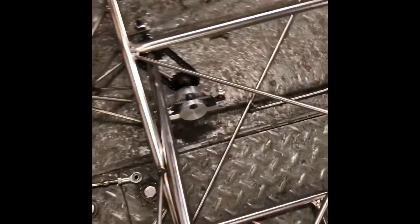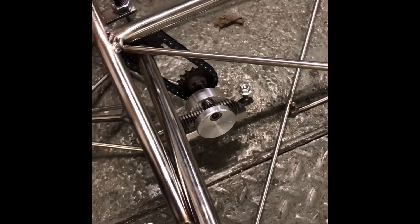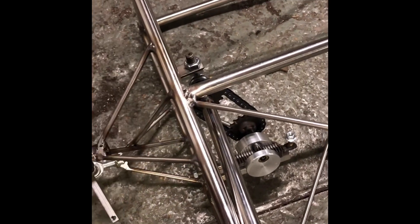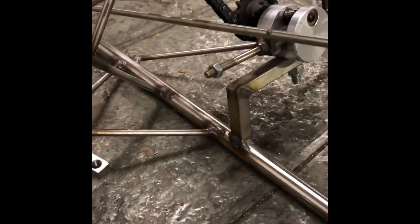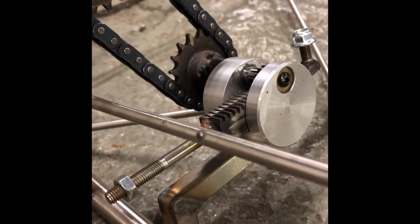Back with a bit more chassis work. The rack I made is nice and smooth, but there are lots of joints because I've got a chain drive down to the rack. I thought I could just use a larger sprocket to get a bigger ratio between the steering wheel rotation and the wheels — so it's a bit less like a go-kart, which is very direct and about half a turn lock to lock. This should be a full turn lock to lock. I'll put a larger sprocket on and just have a lever with no rack — that's what I'm going to do now.